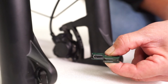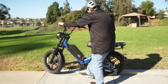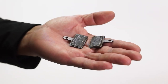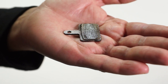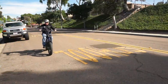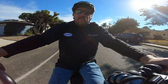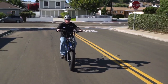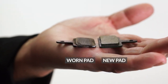Changing your brake pads on your Juice bike is a part of normal bike maintenance that needs to be done on any bike, whether it's electric or not. We recommend changing your pads if they are worn out, contaminated, or if you want to switch the compound material. Checking the brake pads about every 500 miles is a good idea to see if they are worn out — you won't necessarily need to change them every 500 miles; it all depends on how you ride. It's time to replace the pads when there's about 25 to 30 percent pad left.